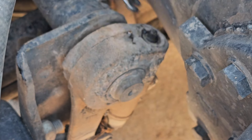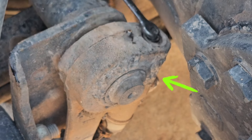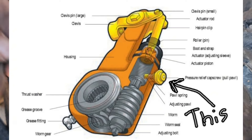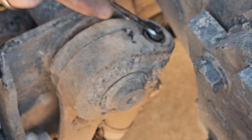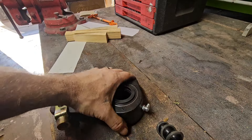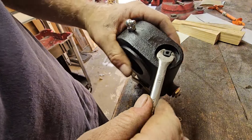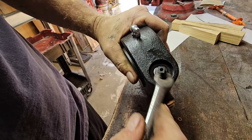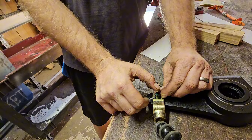Normally to do this you have to pull out on that pressure relief cap — that pawl back there. I didn't have to on this one, so something inside of it was broke, which was causing the brakes to not press against the drums as they should. It was all out of whack. If you go clockwise like I was just doing, you shouldn't be able to go that direction unless you pull out on that pawl. This is the way you would go to engage the brakes — it's like a ratcheting system. For every click you hear, you won't be able to go back the other way.